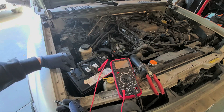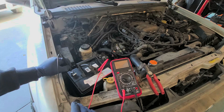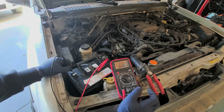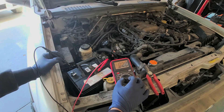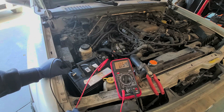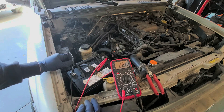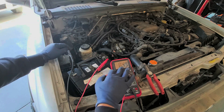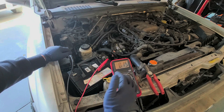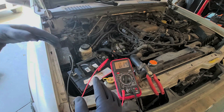I've got a little hose clamp to help wedge in our multimeter leads since it's kind of hard to hold them in contact. We'll go ahead and put in the hose clamp so we can wedge the multimeter in just like that. Turn on the multimeter — when doing this you might see a little spark. We're going to switch it to 20 amps and wedge it in. Right now we're reading 0.45 amps, which is way too excessive, but it's coming down as the computer finishes initializing.